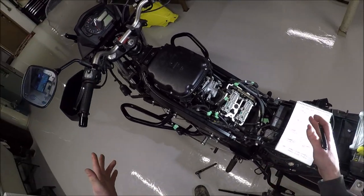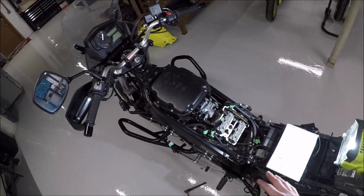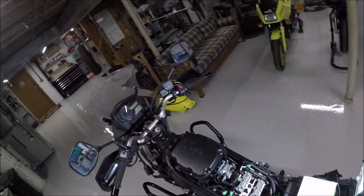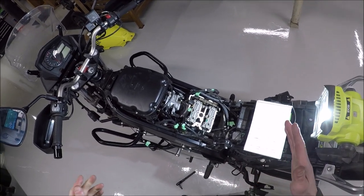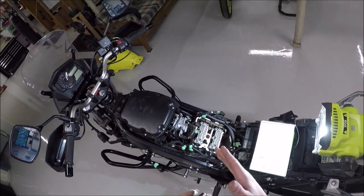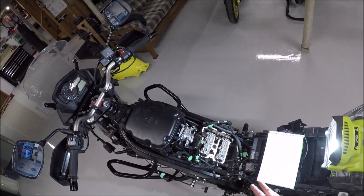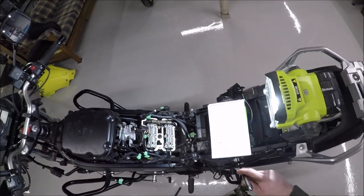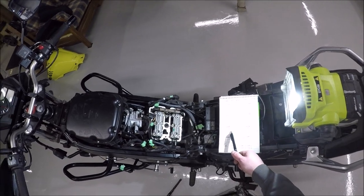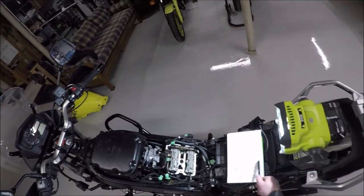I'm a little nuts about this in that I don't want to do this again. I still expect that if anything, it's going to drift within the first 10,000 miles. Valves in 99.8% of cases tighten up over time — it's really rare that wear actually increases the valve lash. Realistically, I'd like to be at 0.011 on the exhaust. 0.006 tight is fine on the intakes, though I'd probably rather be 0.007 tight. But this isn't enough for any concern.